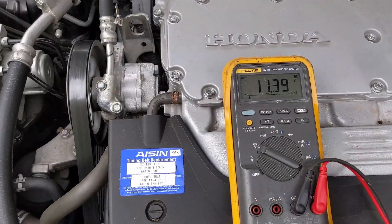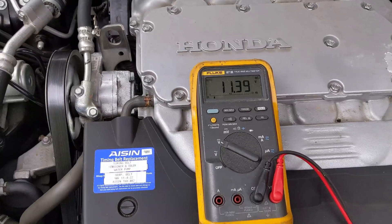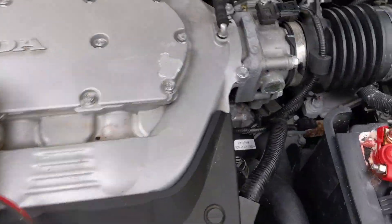I just have my terminal stuck on the battery there so it's moving a little bit, trying to make sure I'm getting a good connection. I'm trying to figure out if I've got an alternator issue or something else going on, because these do have the ELD sensor.